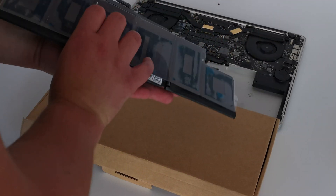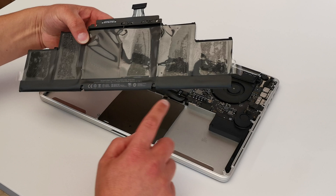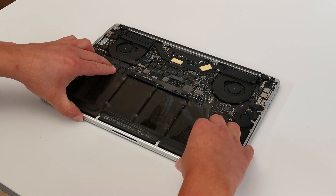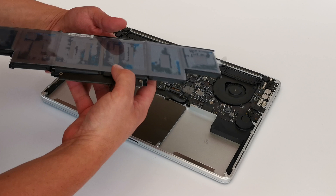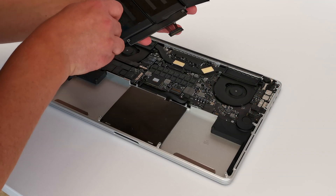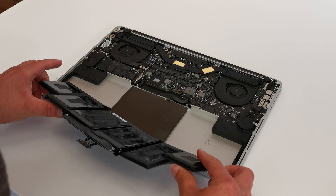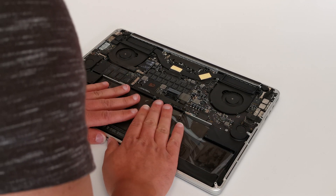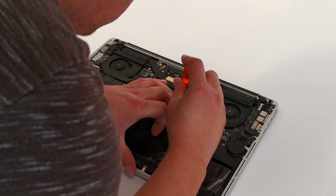Now a quick look on the underside of the battery — you'll see it's covered with a plastic cover. Underneath that you've got your adhesive pads already attached to the battery, so it's just a case of lining up the battery in the case, making sure it's straight and going to fit correctly, and then laying it down. Once you're happy that your battery locates securely into place, remove the plastic off the battery to reveal the pads and then relocate it in place. Take your time to get it perfectly lined up before you press it down — you don't want to be having to get the battery off again. Next, reseat the connector to re-energize the board, then replace the two screws that hold the battery in place.